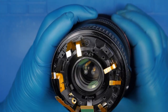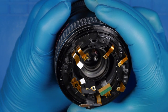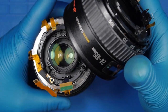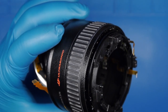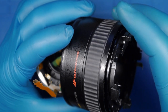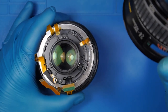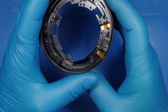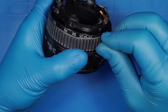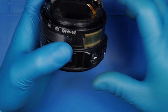Okay, so now very gently you just pull off this group. You must be very careful when putting everything back — try to remember the position. There's only one way to put this back, so there's no necessarily a need to mark it, but if you think you need to, just put some signs on the sides. So next step we'll disassemble this group — we have the zoom ring and the switches for autofocus, manual focus, zoom, and image stabilization on/off. But before we do anything, we need to take off the contactor brush, which we should have done before starting to remove the zoom key.